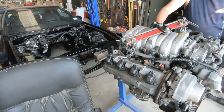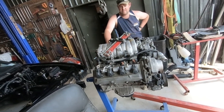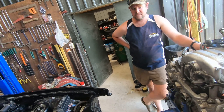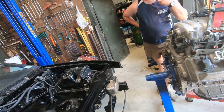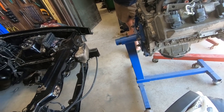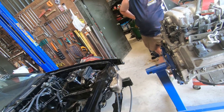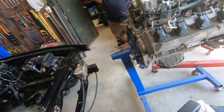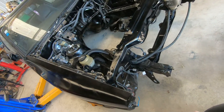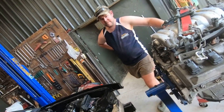Pretty much wiring - as long as I get the wiring done. Sort of gearbox, clutch - you just got to go get a clutch and put a clutch on. There's a spigot bearing to go in too, so we don't forget the spigot bearing because it hasn't had one put on it. The gear stick lever - that's the only sort of major thing. Throttle cable is going to be this week, but clutch master might not be until next week - after the third in the new year, which will be a pain. I'll see if there's something to be done - put a Hilux one in the meantime, or that one out of that Hilux. I've got an oversized three-quarter that I can put in - just depends whether that bracket's out wide enough.